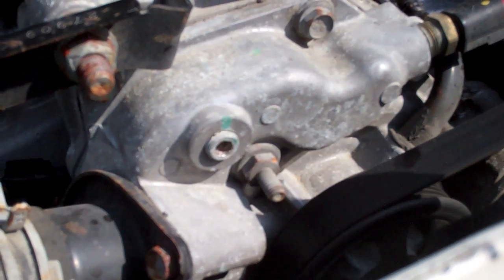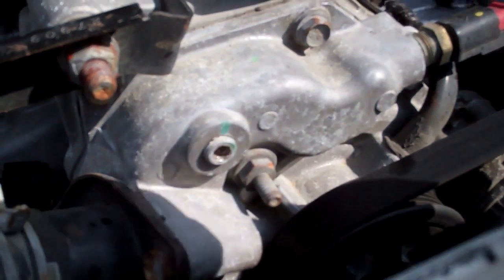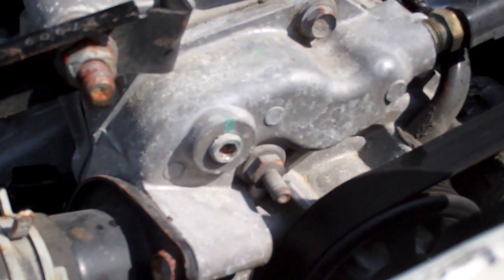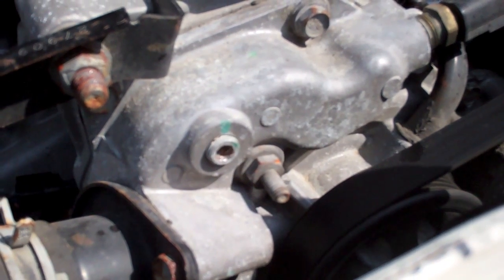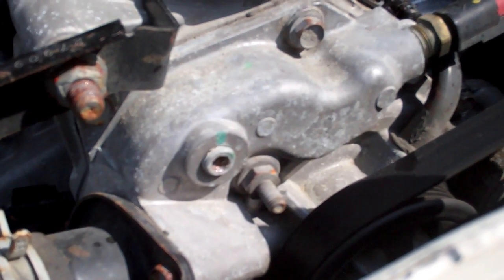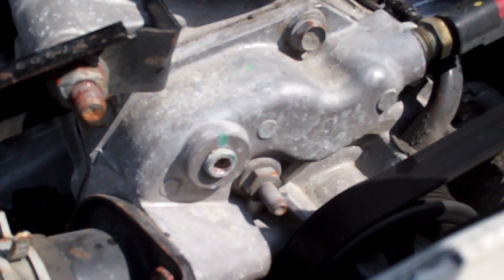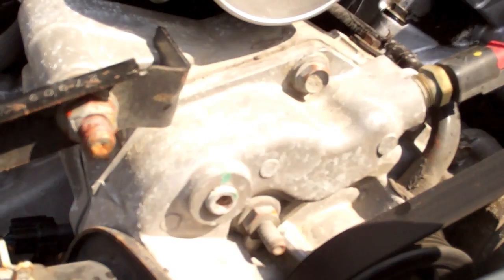I removed the ducting between the air filter and the throttle body just so you can get a better view. This is one of those things that just frustrates the crud out of me when you have a used car. You can tell here this is supposed to be a hex key — probably a size 7 metric would be my guess — but you see it's all stripped and rounded out. That was like that when I got it, so God only knows what they tried to put in there. They failed and just stripped it out. Since this part is vital to replacing the coolant, I'm going to have to get this out of here. I'm going to try one of these star pattern tools and see if I can get enough grip in there.